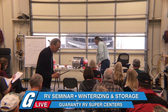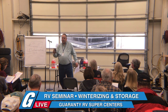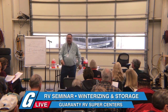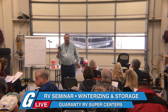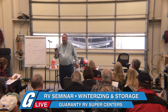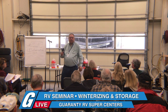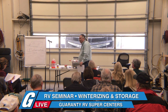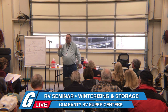Okay, for the big one. After you score yourself one of these little fittings, hook this to your city water, and now the low point drains are still open, the water heater is open, you hook this up and you put air pressure to it, hopefully you've got 60 to 80 PSI, we run 130 in here, and we run full pressure, we don't neck it down, but we always have at least two faucets open. So the first thing we're going to do is we're going to blow air out, and it's going to blow a whole lot of water out the low point drains and out the front of the water heater.